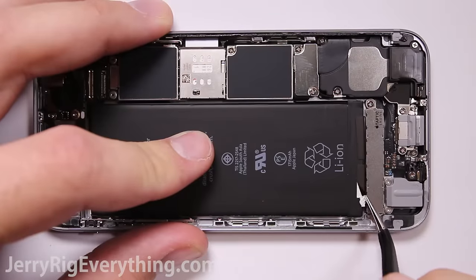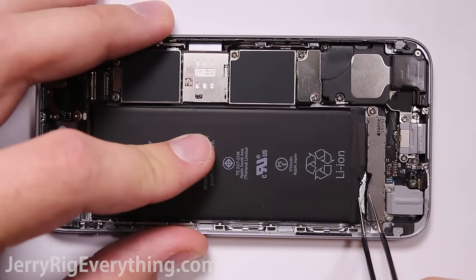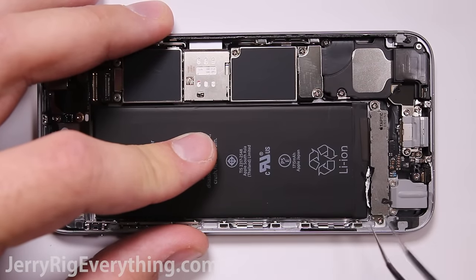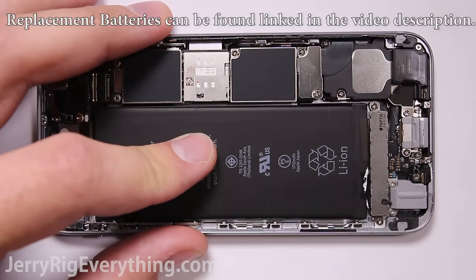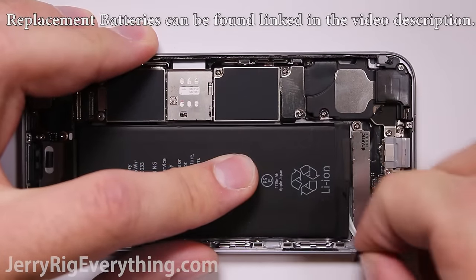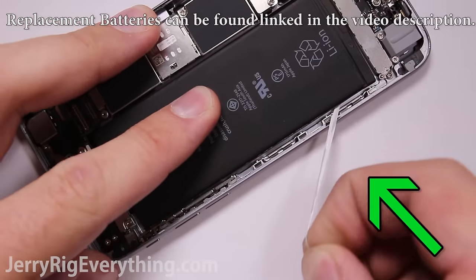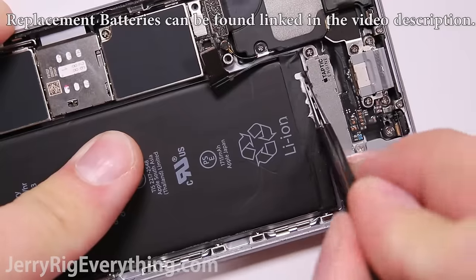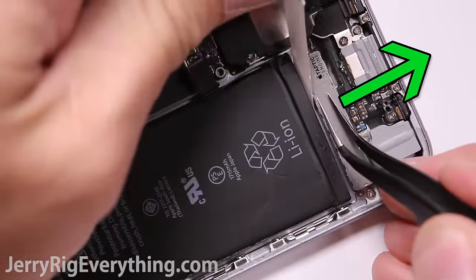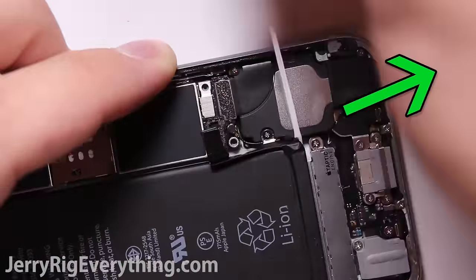Here's the wrong way to remove the battery. There are two little pull tabs at the bottom — you can see them being unstuck from the battery. They're kind of hard to grab because they shrink up as soon as you remove them. Here's where I went wrong: I took the pull tab and pulled it through the side of the phone, which makes the pull tab break and turns it into a much harder repair. If you grab the pull tab, pull it straight out the bottom of the phone — don't try to wrap it around the battery.